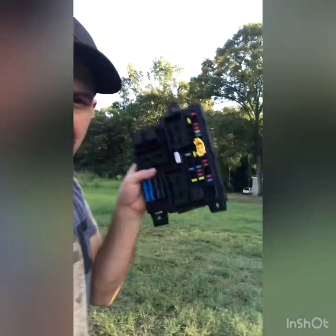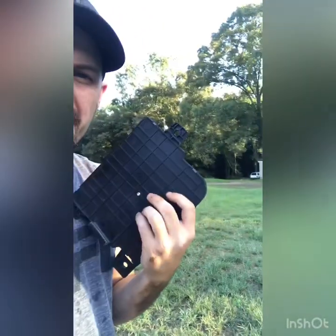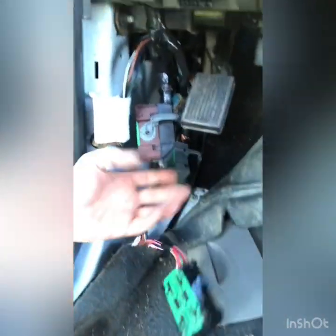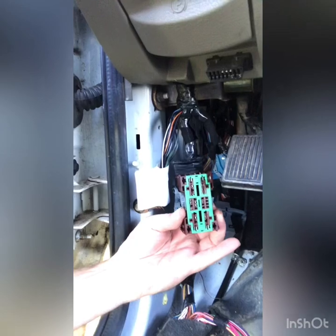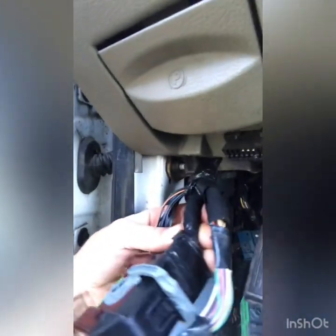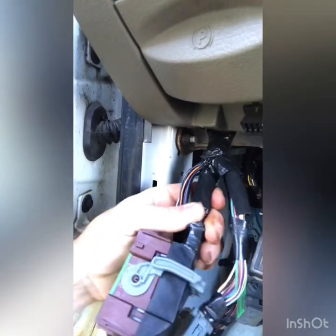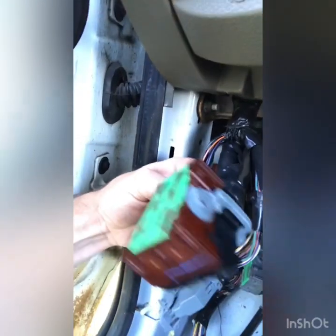All right you guys, we got it put back together. Got all the components back in. Everything's good and dry. We got the screw in the back and we're fixing to put this thing back in, but before we do, we're going to take some air and blow all the water out of these to make sure there's no water in here. The water I've been noticing is staying up in these harnesses — they're staying damp. So you've got to make sure you get all this water out because it'll run in later.